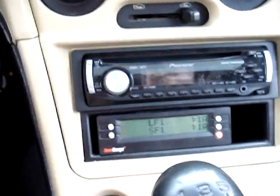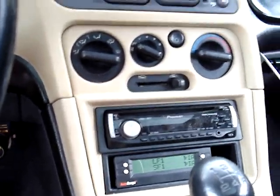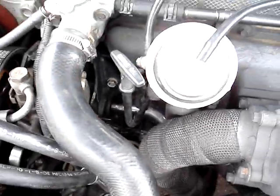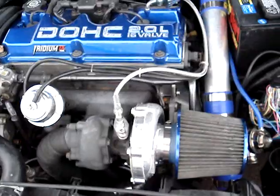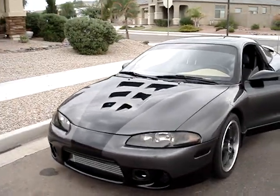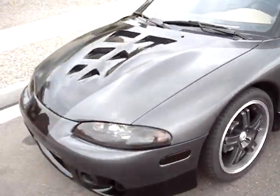This one shows the air temperature entering your intake — pretty useful. While driving it should be just a little bit higher than outside air temperature, but my intercooler pipe runs kind of close to the exhaust, so it's probably a little hotter for me. I wrapped the exhaust and the bottom intercooler piping with some heat tape, so I think it helped a bit. I need to extend my air breather out to pull fresher air — right now it's pulling air blown from the fan. Other than that it seems like it's running pretty good. I got my bumper on too. So this is the product of the project — there it is.